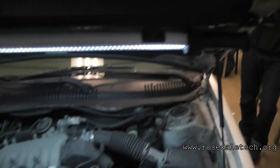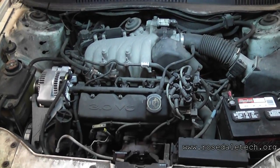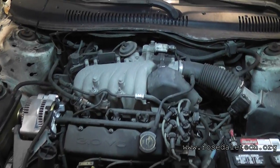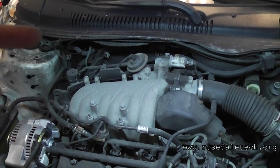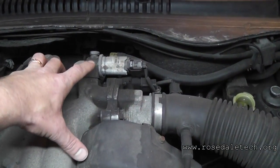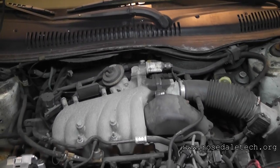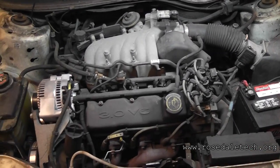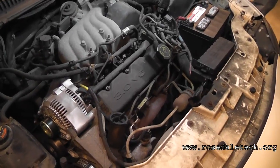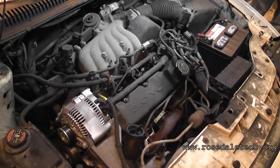Our EGR — typical Ford — is leaking. Idle air control valve around the breather area leaks, but that's normal on those. Lots of oil leaks on this system. Anyway, not really sure exactly where our problem's at yet. Relative compression, then injector balance, in that order.